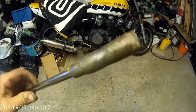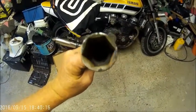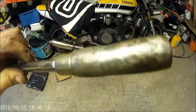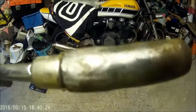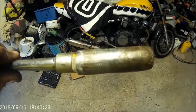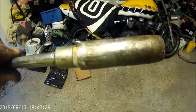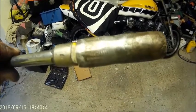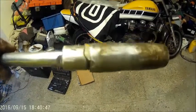Quick update: I had to grind this socket spanner down. If you look at it, there's probably only about two to two and a half millimeters left on the actual socket. I ground it right down with a scouring disc, because the holes are really, really small, and for some reason the valve cover top doesn't really line up very well with the head.